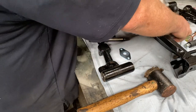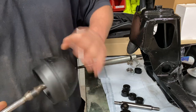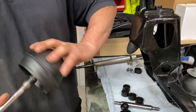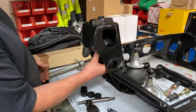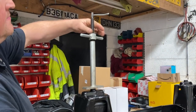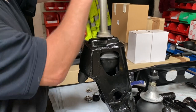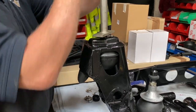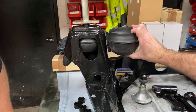The next job was to fit the cone in place so we could fit the top arm in. The thread of the cone can sometimes be a little tight on the tool used to compress the cone, so a tap of the correct size was run through it first just to make fitting easier. Fitting the cone itself was fairly straightforward too — it was placed in sideways first, then turned once it was in the tower of the subframe. The cone needs compressing to allow some of the other parts to fit in easier, and the cone compression tool does this job perfectly. You can see how much the cone has reduced in size when compared to the non-compressed cone.